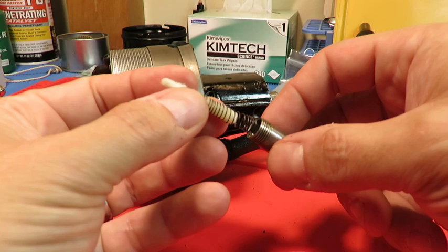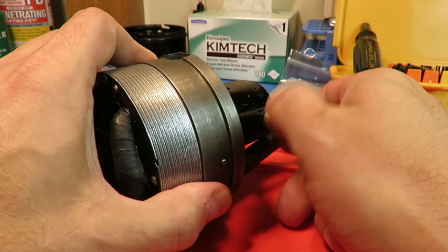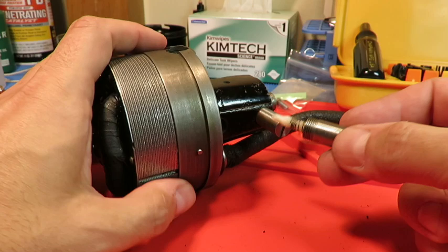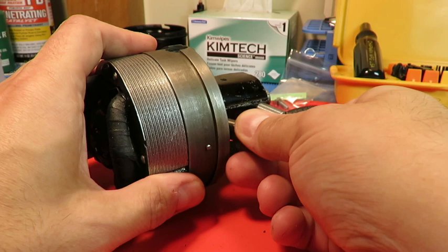There is a bit of debate among everyone who likes these sorts of things too, as to what kind of grease and what sort of lubricant to use. The old manuals and such would tell you that Singer motor lubricant is the thing to use, although that's been in various stages of production over the years, and many people who work with these kinds of vintage machines think that the current produced Singer motor lubricant is no longer suitable for this kind of felt wicking kind of lubrication of the motor shafts and such.